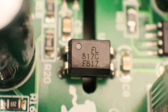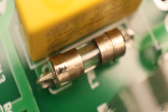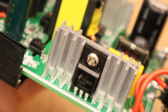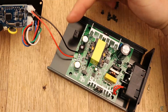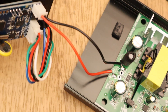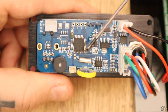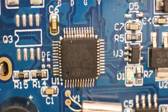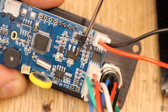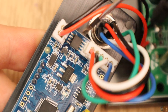I can also see another internal fuse soldered to the PCB. Now this is the 20A 60V power MOSFET and I thought this is the one that controls the power applied to the heater, but that's not true, since between the power board and the controller board there are only the supply wires. So now on the controller board, I can see an STM32 microcontroller that will control everything. I can see some voltage regulators and two more ICs. This one here is the MOSFET for the power control.